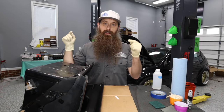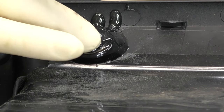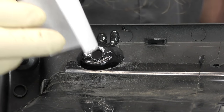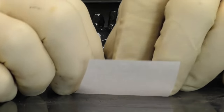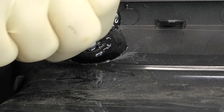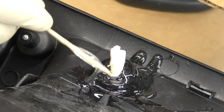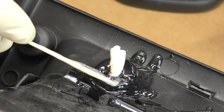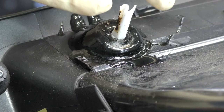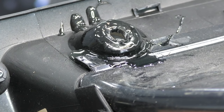Now that our instrument cluster is all done and taken care of, let's jump back to our glove box. For the one here on the end that's pretty close to being complete, we have some epoxy filling in most of the gap, but I do want to build up a little more epoxy behind the first layer to make sure it's nice and strong. I'm going to take a small sheet of parchment paper, roll it up fairly small — small enough to fit through this hole — and slide it up through that hole. I don't need a perfect seal; I just need it to prevent a ton of epoxy from going down that hole. Now I can mix up another batch of epoxy, fill in the part that's not fully filled in, and let it cure. After about 30 minutes, that should be enough time for it to hold its structure — it'll still be tacky to the touch, but we can go ahead and get our parchment paper out, then let it cure the rest of the way.